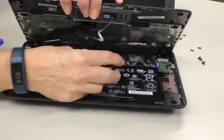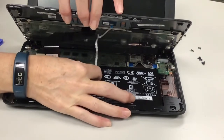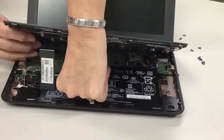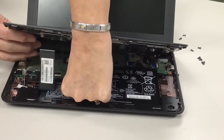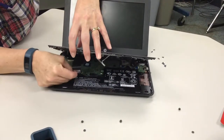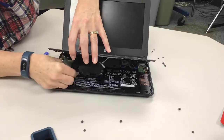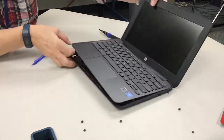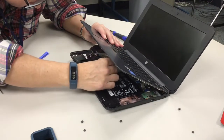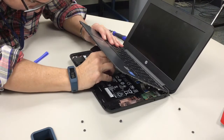You stick the little blue piece of tape in and then clamp it down with that white tab. I call it a tab, but as you can see, it's a little tricky. So I usually give up on that one for a minute. The bigger one for the keyboard is easier. So once you snap it down, if it's engaged, it won't pull out. If you engage it and it doesn't come out right away, then you've done it correctly.